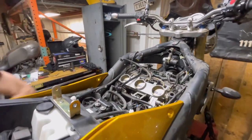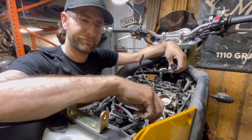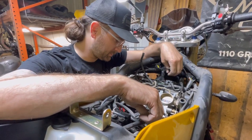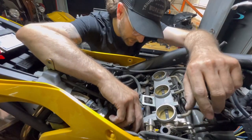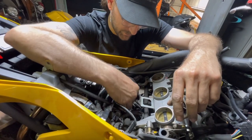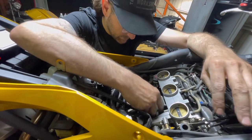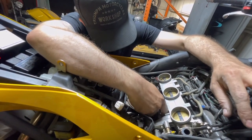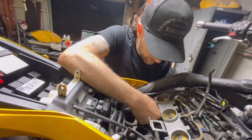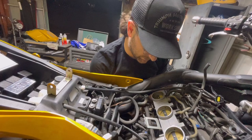The air box is off. I just can't forget to reconnect all this stuff. Fuel line goes. And I want to take the injectors off so I can clean them. It's going to be really fun, because I bet they are clogged with old gas. It would suck to put it all back together if it turns out the fuel injectors are clogged anyway.